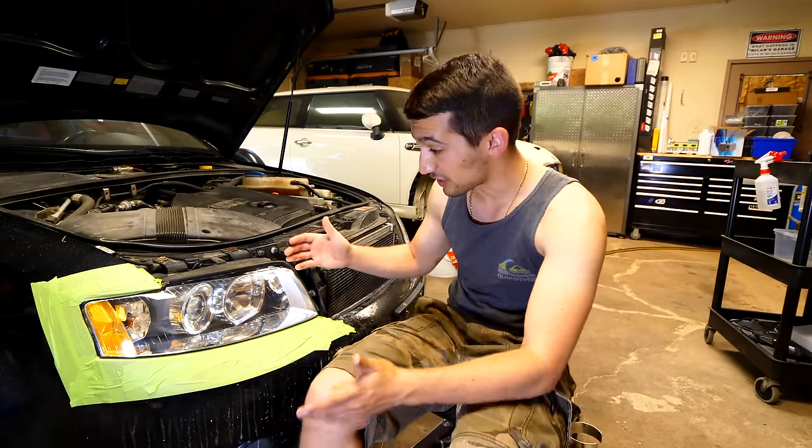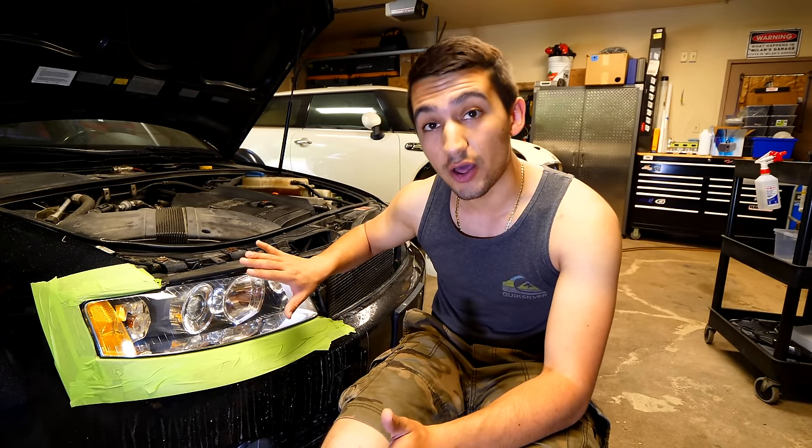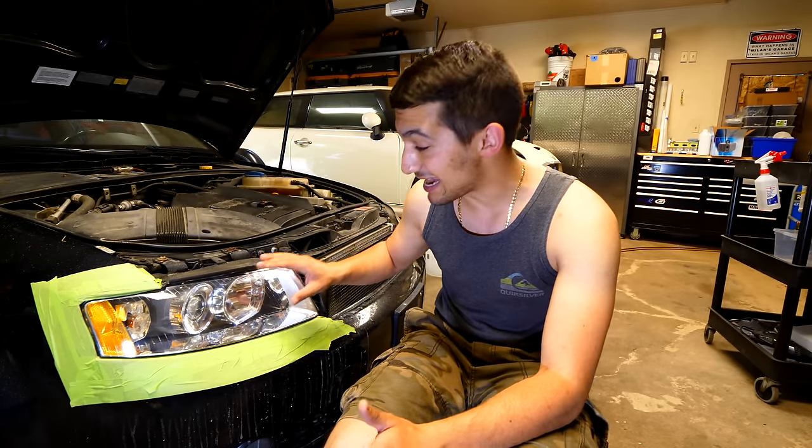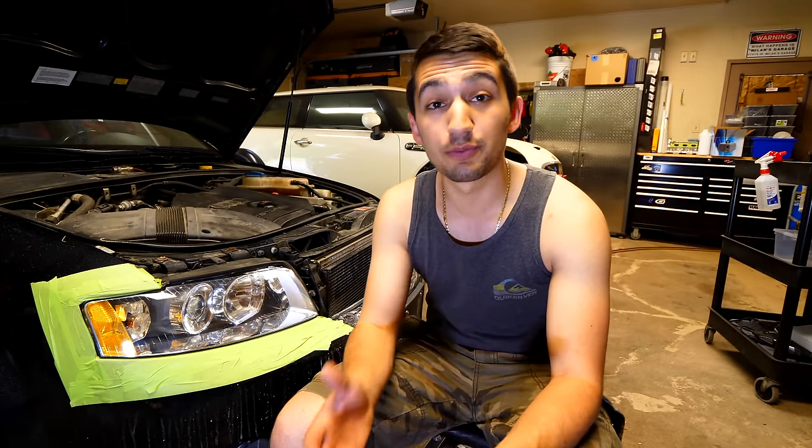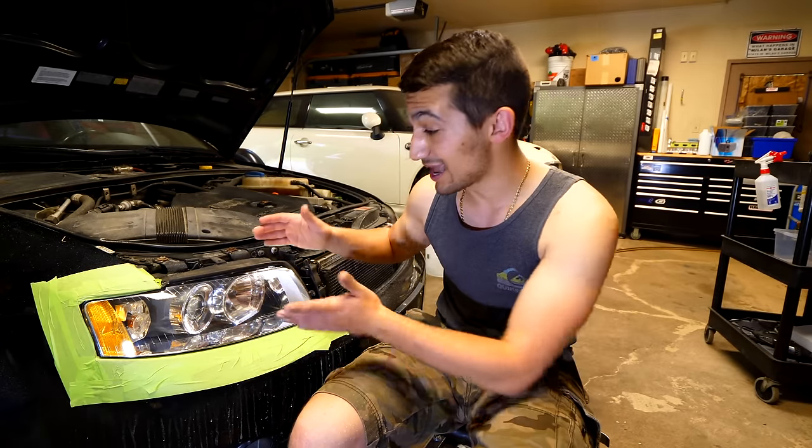With the headlights now in this condition, this is where you would then put your protection over top of the headlight. At this point, this looks like an OEM headlight — it looks brand new, it looks great, the clarity is definitely up there. Now something to consider is that when you clean out all the imperfections on the surface of the headlight lens, you will then be able to see any dirt or junk that's found inside the headlight that you might not have been able to see before because the lens was so clouded. As for the protection stage, you can do many things — you can put a layer of wax on here, or you can put a layer of clear coat over top of the headlight. Those are both great options and they'll keep the headlight looking nice and fully optically clear. But I'm not going to be going that route — I'm going to be going a route that's a lot more durable and a lot easier to change down the road, and that is using paint protection film.